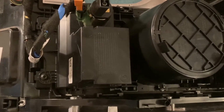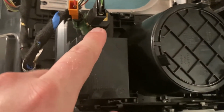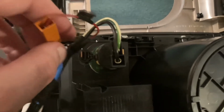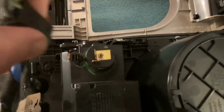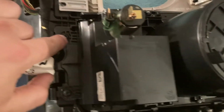Next, it's the plastic bit that contains the cup holders, ashtray, and lighter. Just as before, we first pull the electrical connectors gently. That's 1, and that would be 2. Come on, you. There we go. They behaved. And from what I've seen, there's 1, 2, 3 screws and some sort of plastic clip down there, which I'm gonna have to remove.